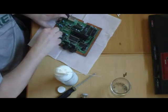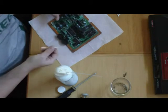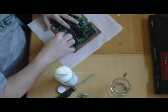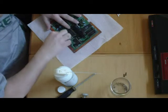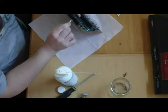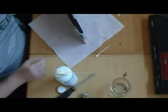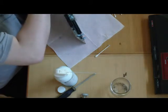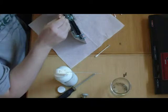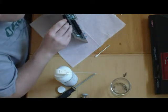Give the power button a little bit more attention too, because those are the things that are exposed to the environment on a constant basis. To clean your controller ports the same way, do the outside of them. For the underside, if you're going to clean the actual prongs — the pins inside — you want to get a new Q-tip with alcohol on it.